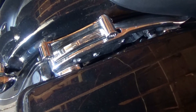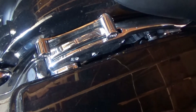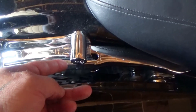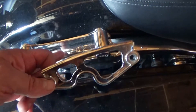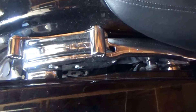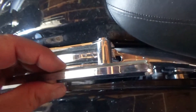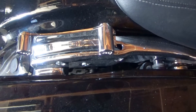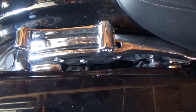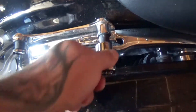Here's the docking station installed. All I did was took off the saddlebags and took these two bolts out. On mine it had these inserts right in here where the docking station goes — it drops into those. So when you take those bolts out you can pull the insert out, slide the docking station in, put the bolts back in with some blue Loctite. And there they are.